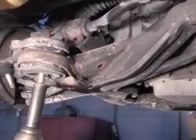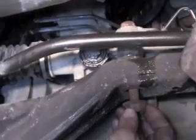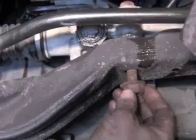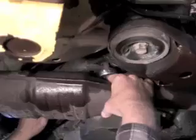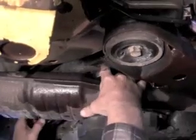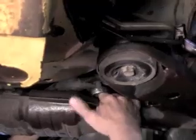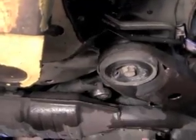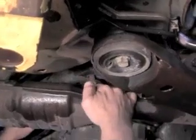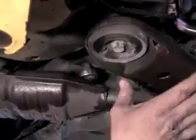So you just have to take the bolts out of the cradle. Now the steering rack itself bolts down through the cradle. It's held on with two nuts. You just need to loosen them. As we're doing the cradle bolts that hold the rack in the main position there, this one on the passenger side is just above the exhaust catalytic converter, and there's very little clearance here, so it'll need to be taken off before you start dropping the cradle.